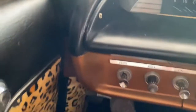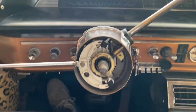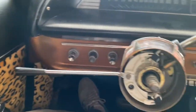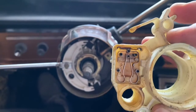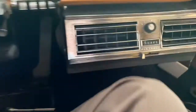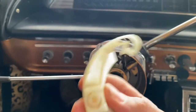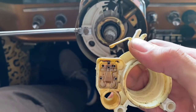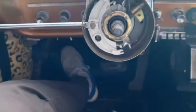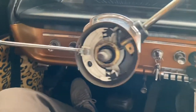I'm gonna try the headlights too because I replaced some of the dashboard bulbs — great, all right! Now I'm gonna do reassembly of the shifting lever and the steering wheel. If you're curious, this is the switch mechanism for the turn signals — just a couple of connections. That little lever under here, this little thing, when you move the switch it just pushes one of those wires to connect to a connection point that completes the circuit.